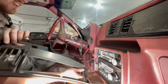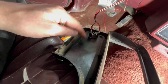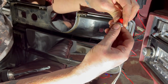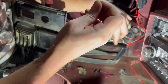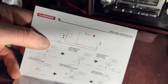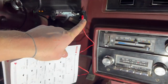You can see where these lights just came through — I went underneath this piece of plastic so I can run my light through there as well. But we've got to drill a hole here to put our light in. All right, we've got our light installed there. It went pretty well actually. Let's take a look at our directions and work on our wire from the fuse underneath there. It's going to be that red wire with that inline fuse. Let's run that through the dash all the way to our black on our switch.